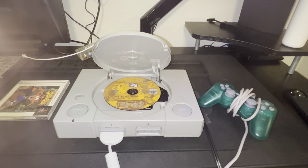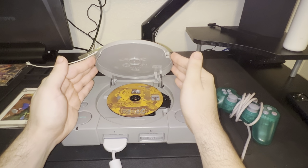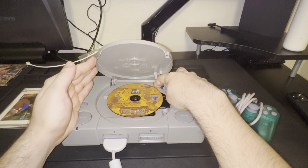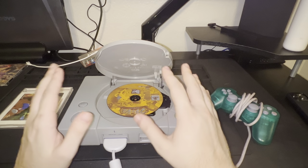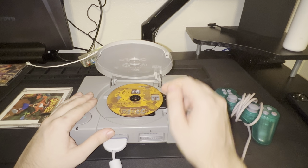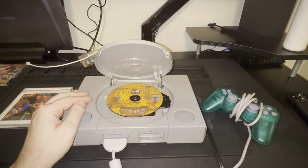Let's go ahead and press the power button to turn the console off. And actually, something that I would like to do is on the console itself, the manner in which the console detects that the disk tray is closed, is that there's this little plastic post over here, which plugs into this hole. And this hole presses a button that lets the console realize that the disk drive is closed, and then the game spins up. So what I'm going to do is press something through that hole so that it could just be pressed down and I could see what this disk is doing.